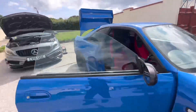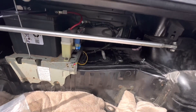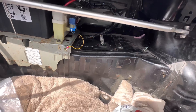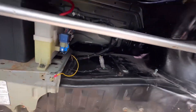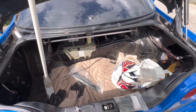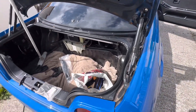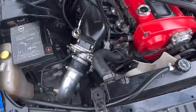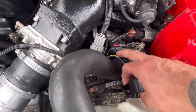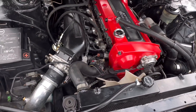I haven't been recording because it's been all boring stuff — just tidying up. The fuel pump wiring for the Walbro 400 was all over the place, so I've cable-tied it out of the way along with the old HICAS plug. Put some electrical tape around all the wires because there was a bunch of loose live wires — a bit dodgy. Tidy again. I've also got a broken sensor to wire in and I'll tape it all up to make it look cleaner.